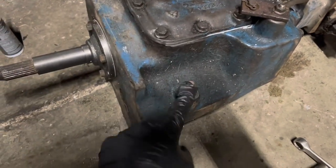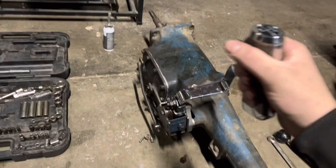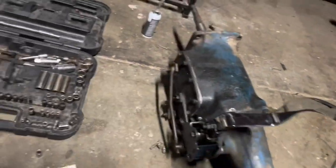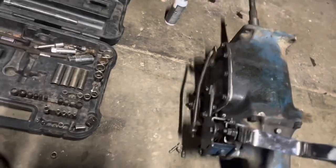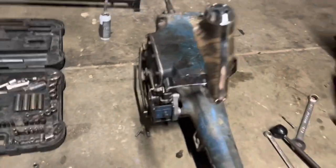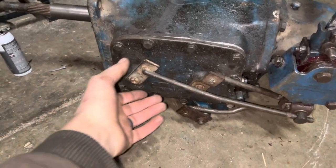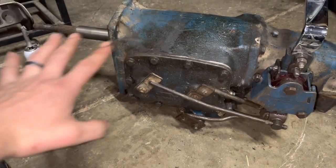Check everything — drain plug was loose too. Just look at it! It's hard to do on the ground. One, two, three, four... and reverse! It's not perfect, but the adjustment on the forward gears is pretty darn good. I kind of like reverse being a little off so you can't hit it on accident. That's just so cool. It actually wasn't fully engaging third gear, so I guess I wasn't centered when I said it, but I'll get to that later.